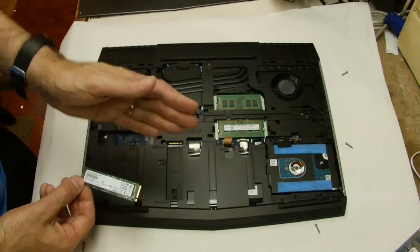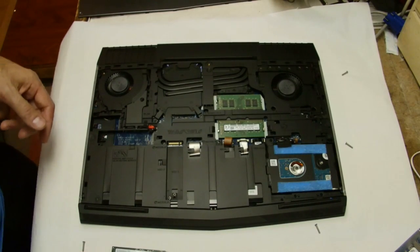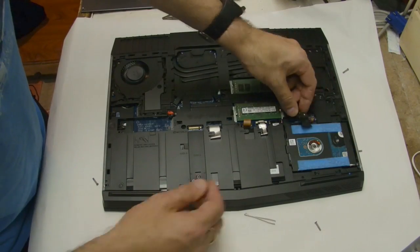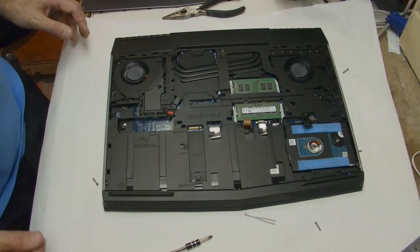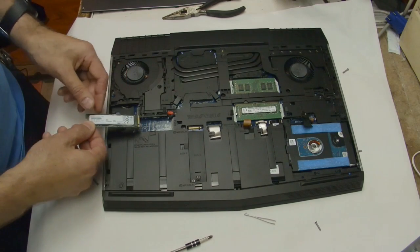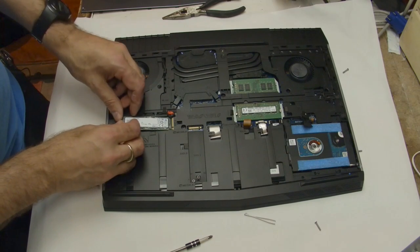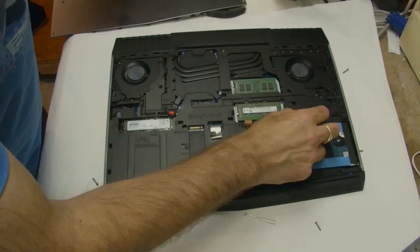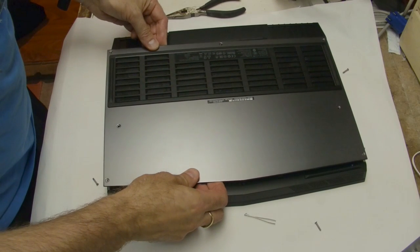We'll put it in slot number two because it's in sequence. There's a little screw here you'd usually have to undo and fasten. Before we do that, we should disconnect the battery cable — the one just above the hard drive — just gradually pull it out. Then you're ready to slot the drive in by the prongs and let it down. Now reconnect the battery cable, replace the back panel, and screw it in place.